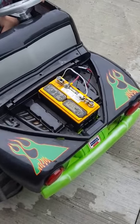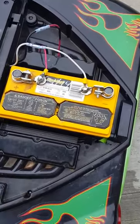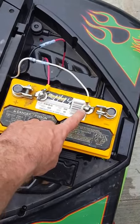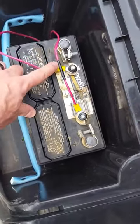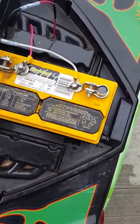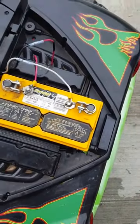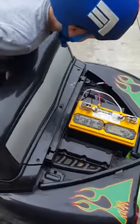Here's the latest edition - we've got 24 volts, two car batteries, so I'm going 12 volts here, looping these in series. The negative of this side all the way through, I ran it up underneath to the positive of this side, and then this negative back here all the way up and through and back to the positive lead on the Jeep. So we've got 24 volts in series.